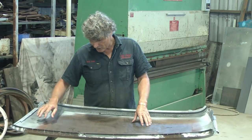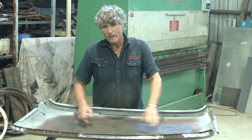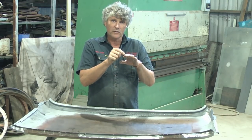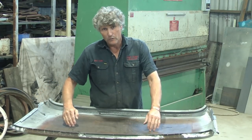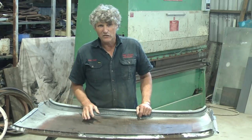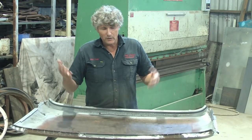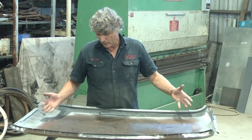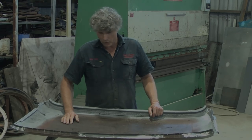Now, particularly with a ute in this era, we have got headliners suspended by steel bows. And the headlining material has got a little calico loop stitched to the back of it, which slides across the bow. And with nothing on the roof, that will chafe on the steel in the roof and cut the calico through. And so if the car gets used, and I'm saying like 100,000 mile sort of stuff, you will wear through that, it will drop down, and then you're up for more repairs. So it just wants something put in there. It could be a piece of underfelt, one of these special proof coats, or a bit of dynamat, any of them will work.